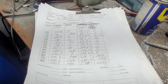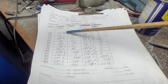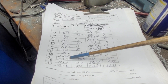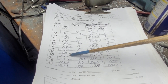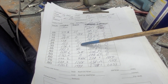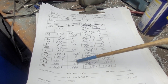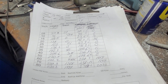Let's take a look and see if the roughed-out Victor made any difference at all. You've seen this before - this is what it was when we took the bone-stock Victor and put it on there. We were flowing about 270, so we took a 50 CFM hit at around 500 lift - ouch. It also completely stomped on the swirl curve - dead, dead, dead until 600. This is because the manifold has a curved port before it goes into the intake port, which changes where the air is flowing inside the port versus a clay radius.